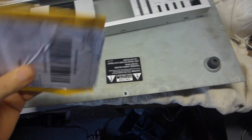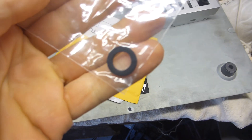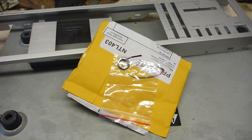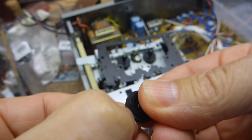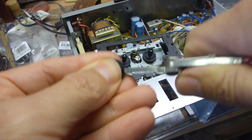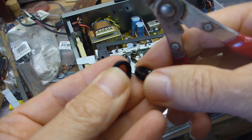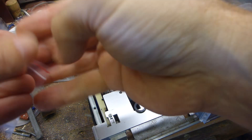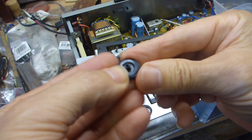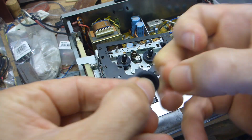The spare parts have turned up - the little replacement rubber jockey wheel. That is the beastie. Let's fit it and see if we can get this cassette player another lease of life. Using a little pair of pliers to grab and pull that off - and that rubber is quite decayed, quite hard. Opening up the new one - there's the new one, that's the old one which has got quite a bit of meat on it. Hopefully that just slips on, and it does. Just have to make sure it's seated okay. Done.